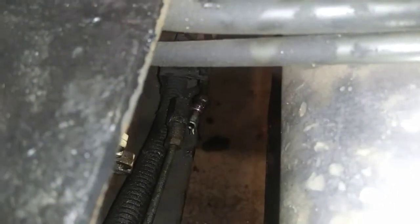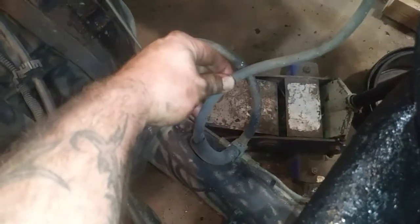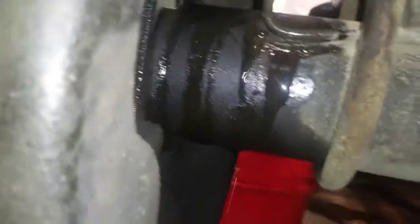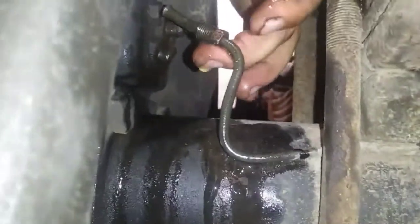That's the way this should look when you're cracking these open — nice and pretty like that. Now I'm going to try the rubber hose. The rubber hose is good — it's telling me fluid is getting down to this point. It's just dribbling down the bottom of the axle tube. Got it popped loose and it's just dribbling. So that means I have a clear path from my master reservoir to both of my wheel cylinders — not what I expected since they are both clogged.